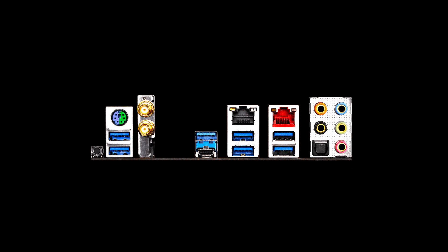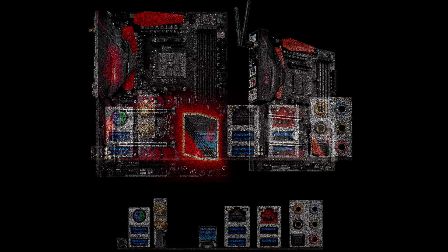On the rear I/O, we have the clear CMOS button, then a PS/2 connector over a USB 3.1 Gen 1 connector. There's a vertical M.2 E-key port supporting a supplied dual-band Wi-Fi module, followed by USB 3.1 Gen 2 Type-A over the USB 3.1 Gen 2 Type-C connectors. There are two LAN ports: the Intel i211 running at 1 gigabit, and the Aquantia AQC108 running at 5 gigabits. Below these LAN ports are four more USB 3.1 Gen 1 ports, one optical out, and gold-plated audio ports with Creative Sound Blaster Cinema 3 support.